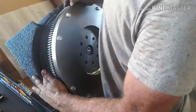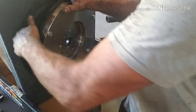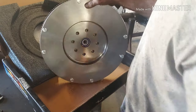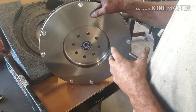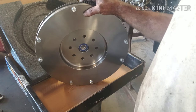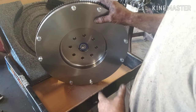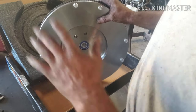This thing is heavy. All the spacing looks right, so this is seriously a bolt-in deal. You don't have to change your starter or anything like that. The 24 valve, just like almost every inline six, is internally balanced. So you don't have to worry about putting a certain hole in a certain spot to keep the engine balanced — the engine itself is balanced, and this flywheel is balanced. So it's really just bolted on. We'll put the eight bolts on and torque them down.